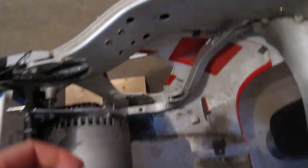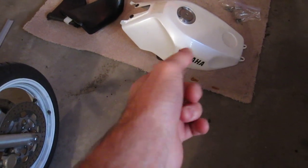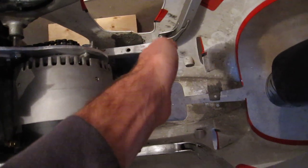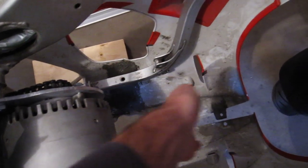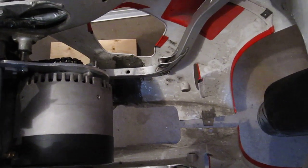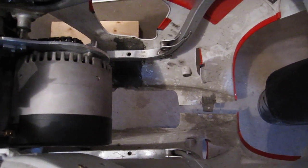It's really tight — with just one inch in between each vertical stack, there's only maybe two to four inches left between the top batteries and the tank. They'll fit in there, I think. My general idea is to run six vertical aluminum angle pieces, or possibly some square stock, coming up. Then I'll have a bunch of cross pieces running across for where the batteries sit. It should be really light and plenty strong because I'm going to tie it into a few spots in the frame, maybe even this big plate, and bolted into this little stringer down here in various places too.